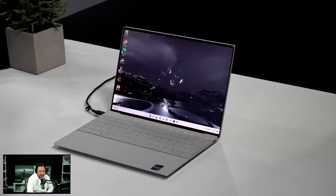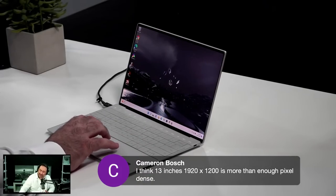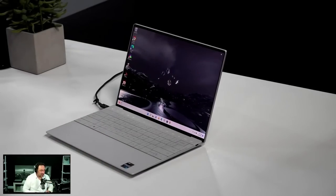For most people, 1920x1200 on the Full HD Plus IPS will be perfectly fine. I chose the OLED model because it has better color gamut coverage and more color accuracy — it's 3456x2160. One thing you won't get on this device is a higher refresh rate option; 60Hz is what you get. Neither does the XPS 15 or 17 offer higher refresh. A 90Hz or 120Hz option would take more battery life, but we should have that option. I'd anticipate seeing it next year.